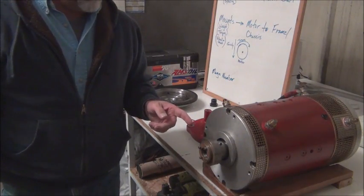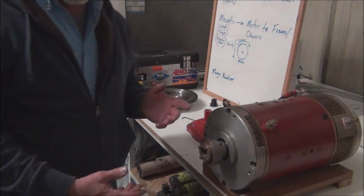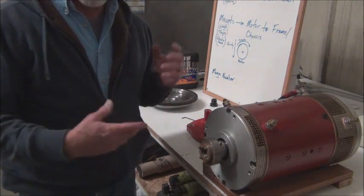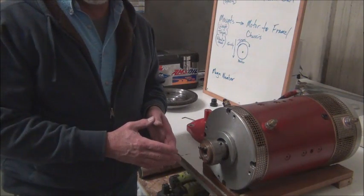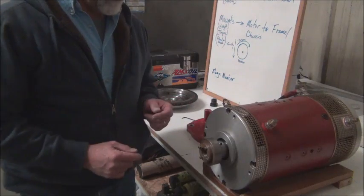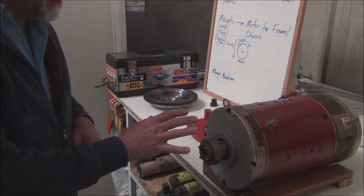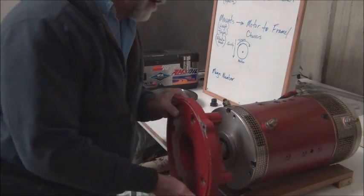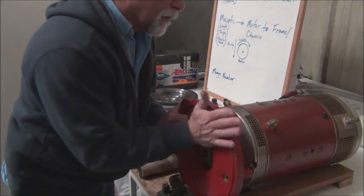Here we have the coupler installed on the motor shaft. I always recommend that if you can — and that was what was easy about a DC setup — you can hook it to a 12-volt battery and spin up the motor. With an AC setup it's a little more complicated, so we typically take these components to a shop where they spin balance everything. But you can check things on a DC motor like this one — I can spin it up and make sure there's no vibration. Once we have this in place, we can install the adapter. On a lot of setups there will be a top, so pay attention to that and make sure things are oriented correctly.